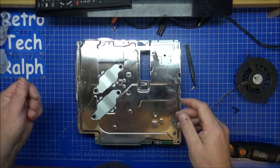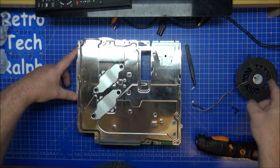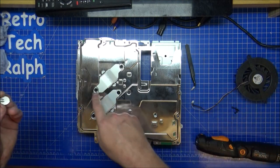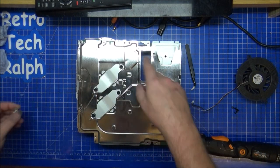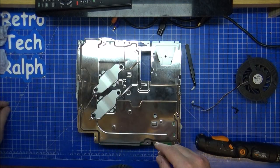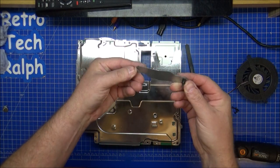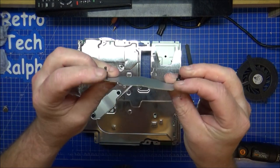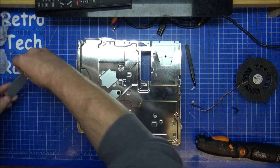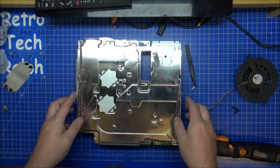Now, I think most screws are taken out. Two down here are the same as what came with the fan, so all the fan black ones are staying together. The screws over here do one, two, three, the five around there. So I'm trying to keep everything on little magnets that I've been keeping from other projects with everything on them. So those two screw straight through. Like I said, there is a little bit of a bend to it, so when it's pushed down, it makes sure that the heatsink is trapped and spreads your thermal paste better.